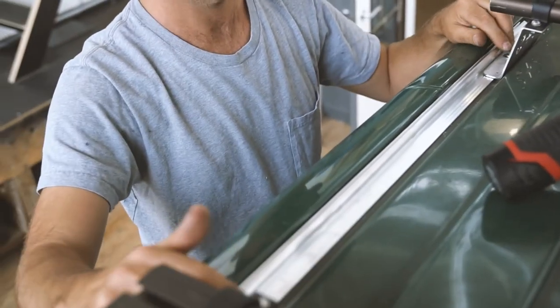So that's it — we now have a universal awning rail fitted onto a Volkswagen Transporter. We've also told you what is inside the box of the Stitches and Steel universal rail — two videos in one. Probably 90% of the guys fitting this rail will be T5/T6 guys, which is why we did that. But it can fit anything — two sections on your Caddy, four sections on your Crafter. If you don't have blanking bolts, simply take the self-tapping self-cutting screws and screw them in. Maybe a blob of Sikaflex to seal it.